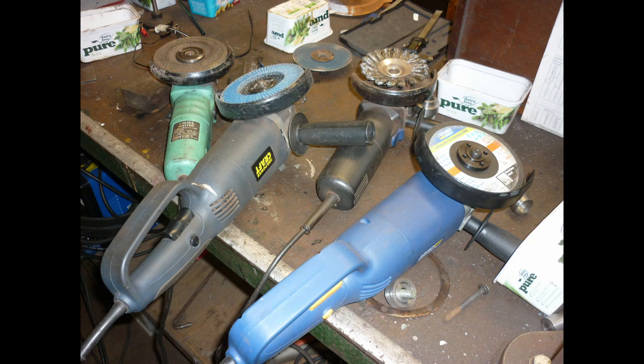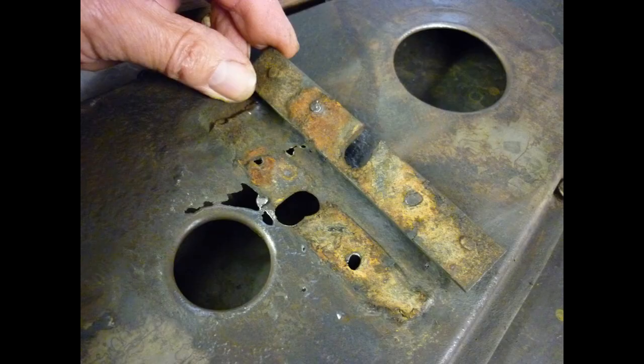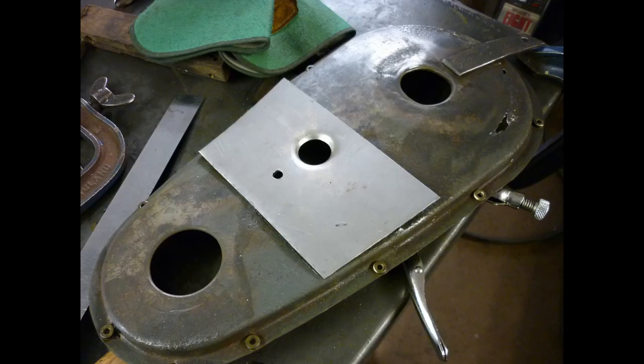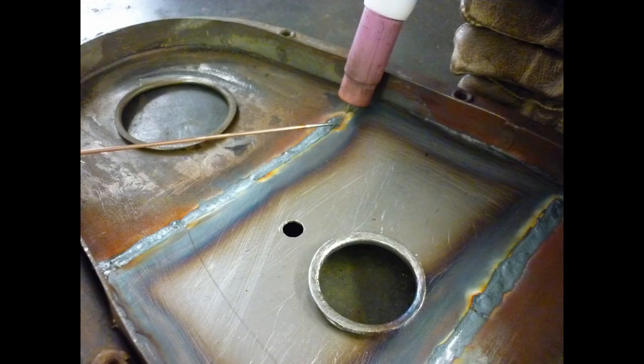Motorcycle metalwork requires wire brushing, cutting, grinding and linishing. A fleet of angle grinders amassed over several years saves a lot of disc changing. The back of the chain case is rotted through where the strap was spot welded on. It's preferable to cut back to sound steel for a simple replacement panel. A reversed gutter reduces oil loss where the footrest support passes through. The position is scribed, cut, and the new section TIG welded in.